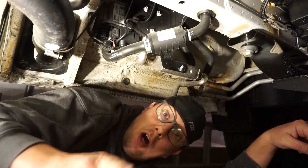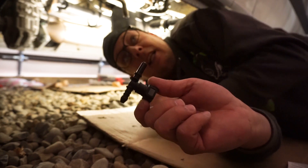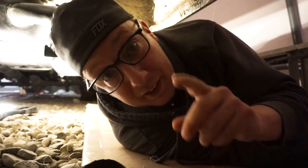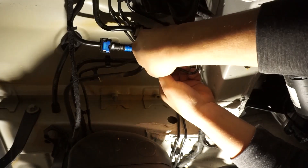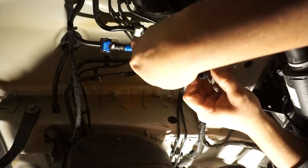I don't want to lose the capability of having a pre-engine warmer, so with this T-fitting we're going to find the fuel line and splice it in so we can hook up the new heater as well. Both can run off the same auxiliary line coming out of the diesel tank. We'll follow the fuel pump line back up to the fitting, unhook the fuel line — and we're good, no diesel spill.